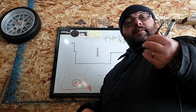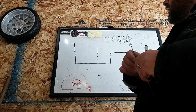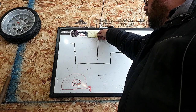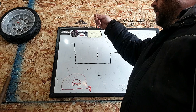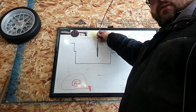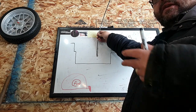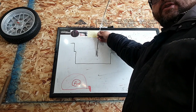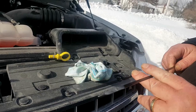They need a lot of oil to keep them running. So when you get your oil changed and they check my dipstick — when the truck had the dipstick put in, they measured the oil and left it a liter shy. This dipstick is measured to know when you've used a liter of oil. What I proposed to my neighbor was: let's do an oil consumption test on your truck, because they said they fixed the problem with the flash on the computer. Let's see if they really fixed the problem or if they're just hiding it. We'll mark the mileage and do a proper oil consumption test, checking it once a week.